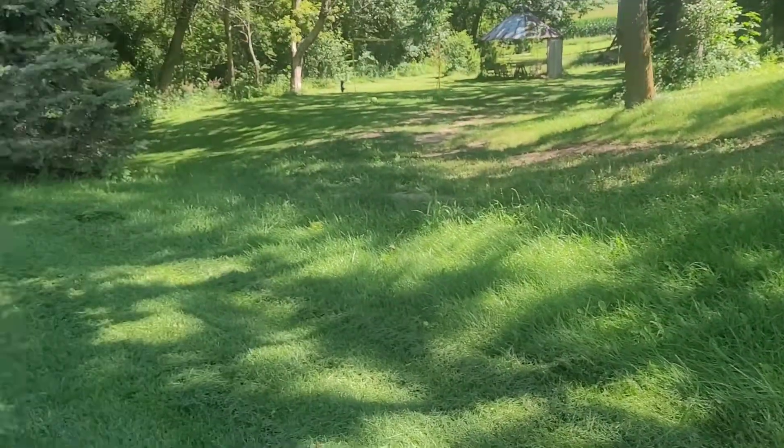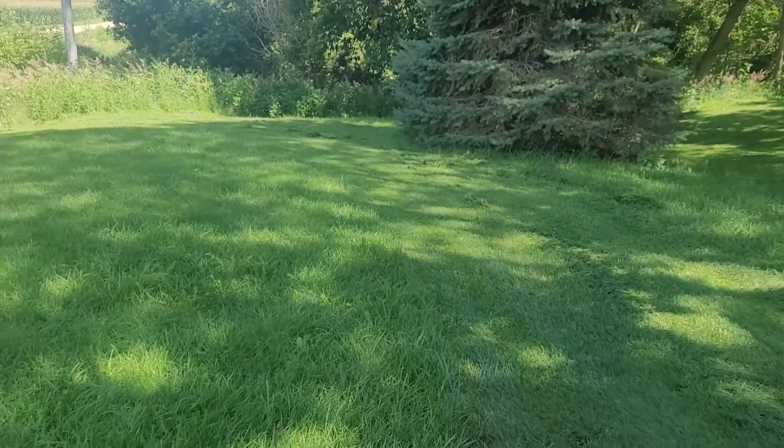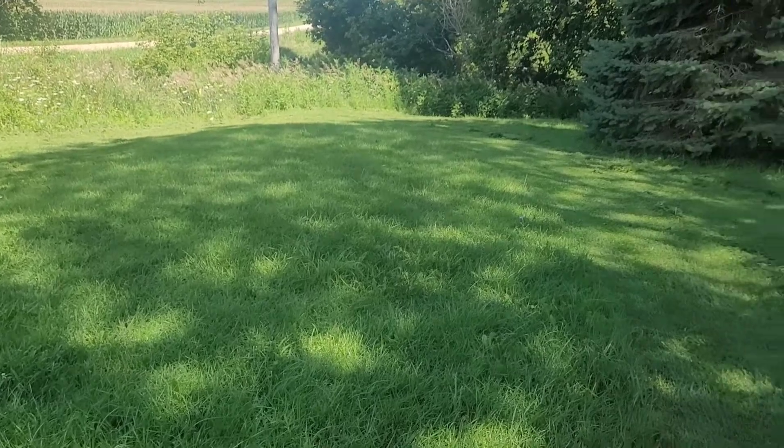And there you go — she's running a lot better now. I just went ahead and cut all this grass here, several inches long, and it didn't bog down once, didn't stall on me once. The same principle for riding lawnmowers applies to regular lawnmowers, boats, airplanes, trucks, tanks — everything. You've got to make sure everything's nice and clean: clean your carburetor out — you saw how filthy and dirty that was — clean out any birds' nests or rats' nests building up in there, change your oil, swap the spark plug and air filter. Let her breathe happy, fire happy, and she'll be a good running machine.